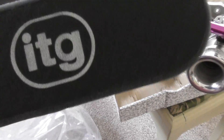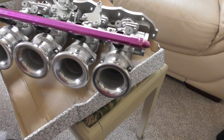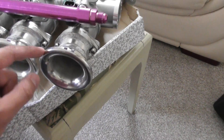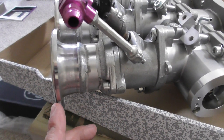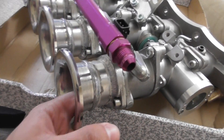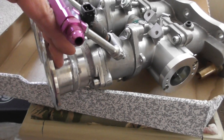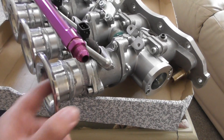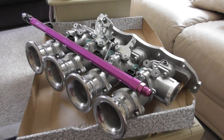The main reason why I couldn't just stick it over the top before is you actually get a lot of flow from the side of these inlet trumpets. If you imagine the air path, you get a lot of airflow from around the side into the main part of the airstream. Now, if you have anything that just butts up right to the edge here, then you're going to lose a lot of this flow into the inlet tract. And that's a big mistake — that can lose you quite a lot of flow and consequently quite a lot of power.